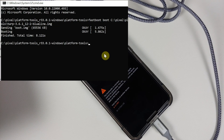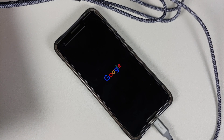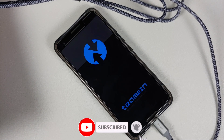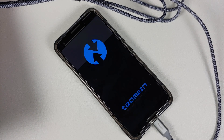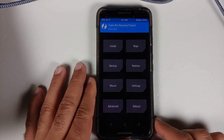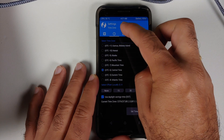Press Enter and you can see it says 'Sending boot image... booting.' The phone will now reboot into TWRP recovery. We can see the unlocked bootloader screen, then the Google boot logo, then the Team Win splash image, and we are booting into TWRP recovery. You can disconnect the device from the computer at this point if you wish.